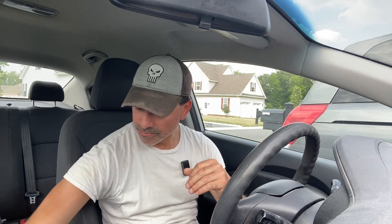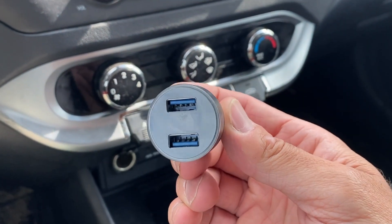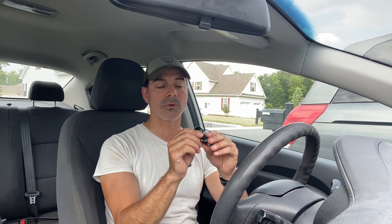What I found is this little device here — you can pick these up online very easily. It just plugs into your cigarette lighter or 12-volt port on your vehicle. Some of them, like this one, have USB inputs as well but also have a voltage gauge so you can track the voltage. I like this because when I'm dealing with newer cars that don't have a gauge, I can put that in and track the voltage and make sure everything's functioning properly. I'll have links in the description — they're just a couple bucks. I'm going to plug it in and take it for a drive to show you how it works, giving you a hand on the pulse of your charging system.